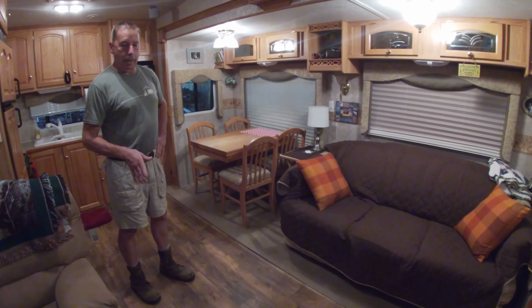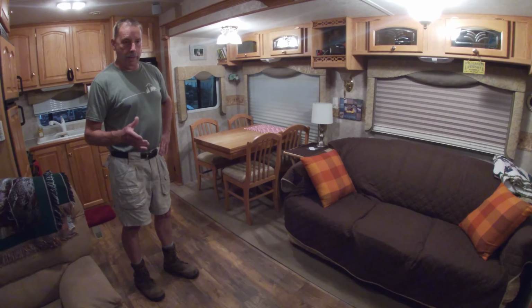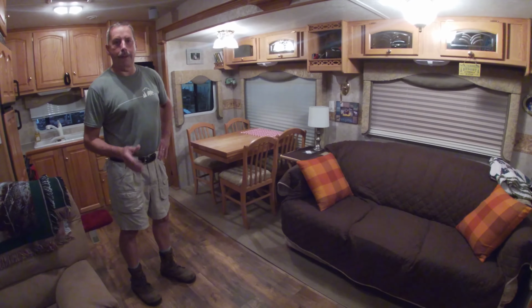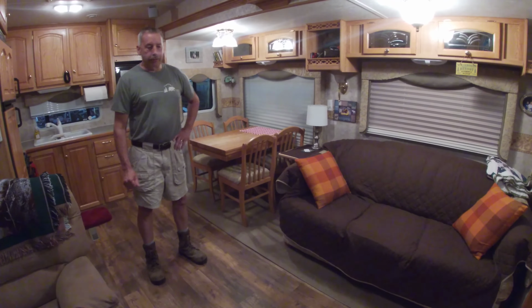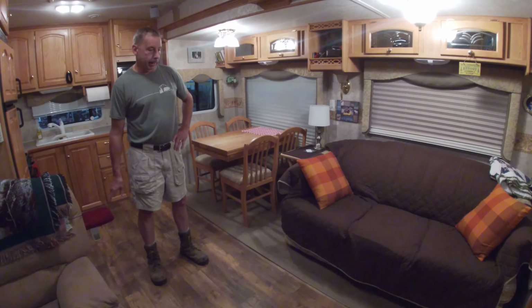Now, inside a camper, it's going to sit all winter, it's unheated. In the summer, it's sitting, and if you're not using it, it can be over 100 degrees. And you put that with the fact that you're going to pull it down the road and it's going to bounce around, you have a chance of some panels separating. So that's why we decided on the vinyl.